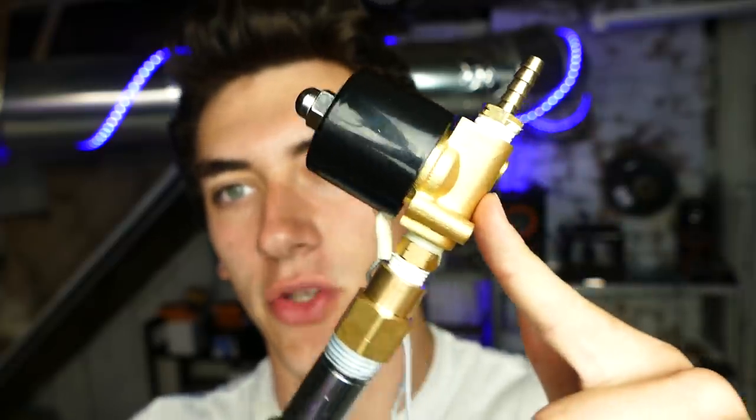So don't take this on the street. If you do try this and get in trouble, just don't drag this video into it. You've been warned. All I did to the solenoid valve was hook up two 9 volts to it, then rigged up a wire that leads off where the switch will be. Pretty much all we have to do is rig up an ignition source, figure out a way to mount it in my car, and then wire up a switch — one for the solenoid valve and one for the ignition source — so I can control it when I do my crazy sick burnouts.